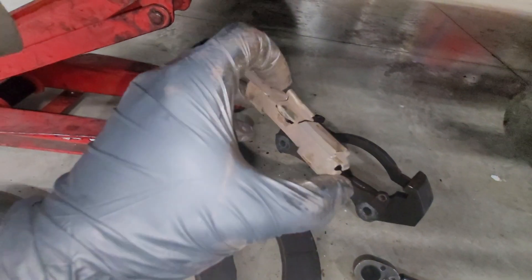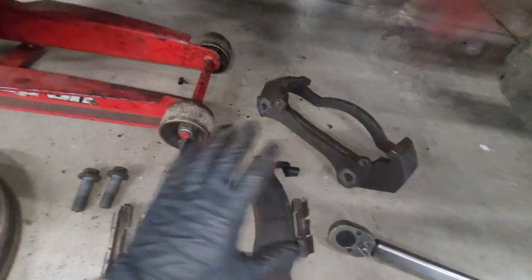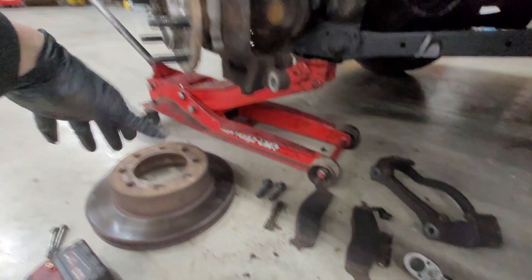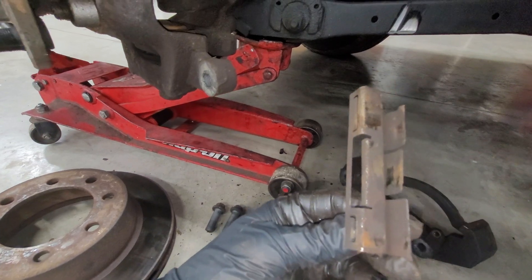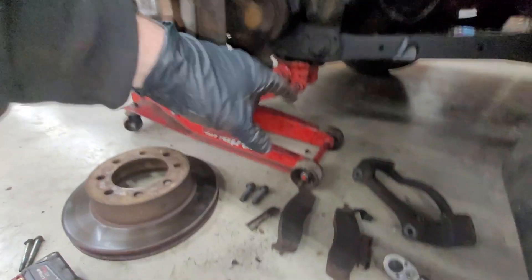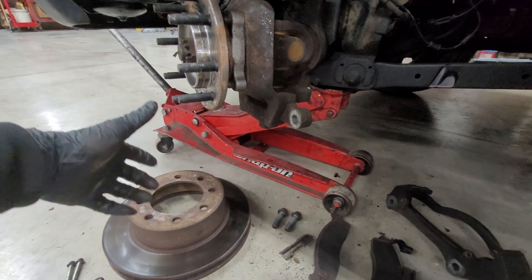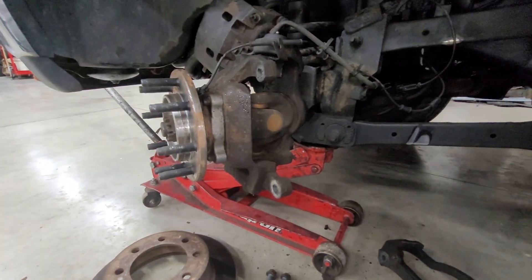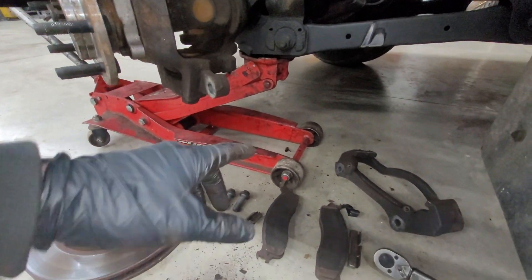I understand it's somebody else's job and I didn't do the brakes. But as I throw this back together, at least this side will have good working brakes. Throw some grease on the slides so that way these things slide nicely. Get all that old crud off there, because if you don't grease and clean these slides, they end up sticking over time. You get warped rotors, warped pads, and even the calipers will stick — just a whole mess of problems. You definitely want them to be greased up.